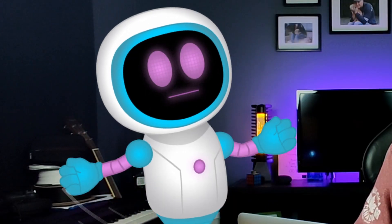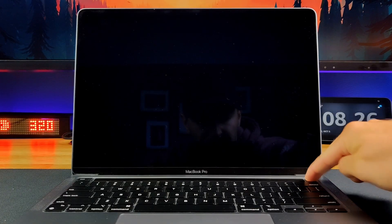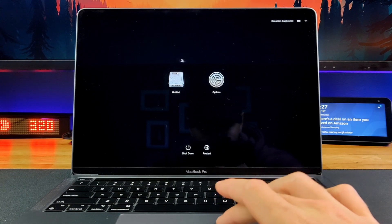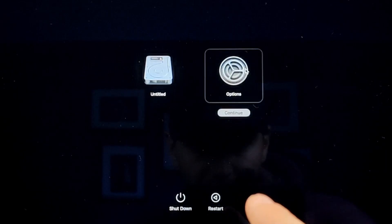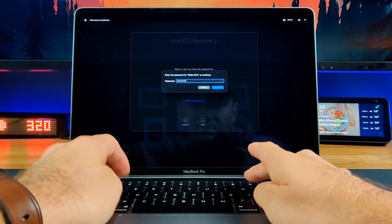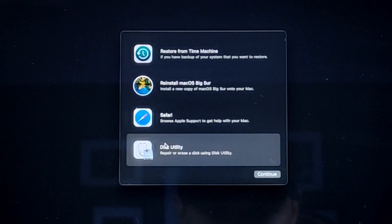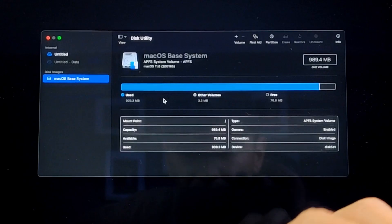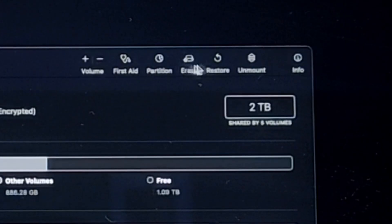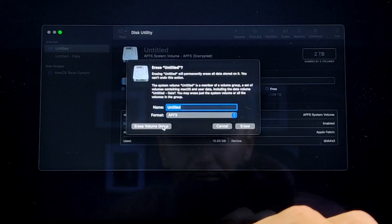Not yet — now it's time for the bigger erase. Step 4: power down your MacBook. Once it's off, on an M1 MacBook press and hold the power button — don't let go. Once your Mac says Loading Startup Options, you can let go. From here, you should see your MacBook hard drive and a gear icon for Options. Click on Options and then click Continue. It may ask you to select a user with a password you know, so click the account and type in your MacBook login password. From this window, go to the bottom and click on Disk Utility and Continue. When this window appears, go to the left column and click on the top drive right here. Then click Erase. Leave everything as default and click Erase Volume Group right here.